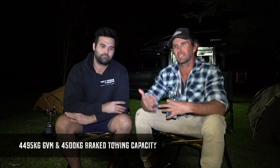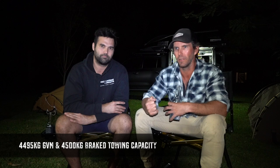With our rig, we've gone with a 4495 GVM and a four-and-a-half tonne braked towing capacity because we've got all the gear and need that big payload — but there are other options. There's Creative Conversions and AEV. For Justin and Bec's rig with that big four-and-a-half tonne van, we used the J-Max clip — AEV are the only ones with the SSM approval to do that conversion, so theirs went to Townsville to AEV. If you don't require such big loading and towing, Creative Conversions offer an 8.2 tonne GCM with 4.2 GVM and 4.2 tonne towing.